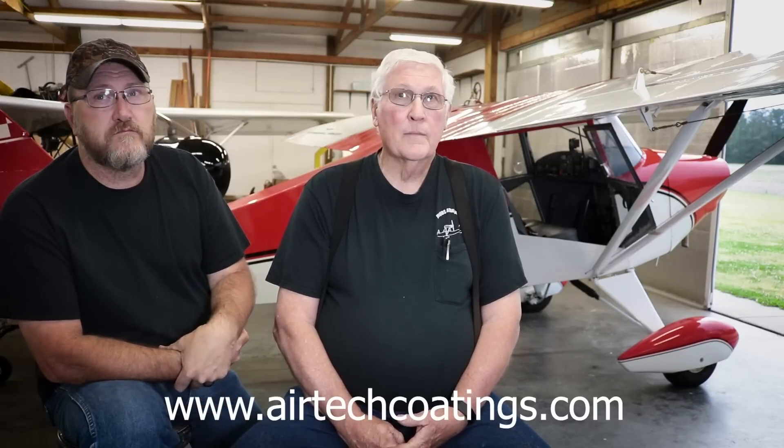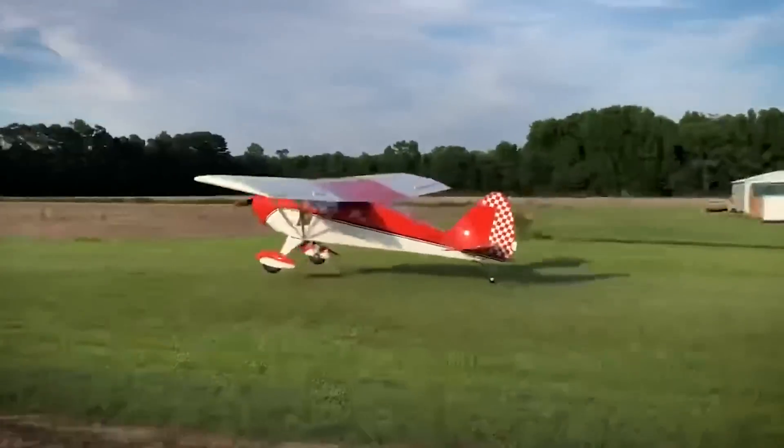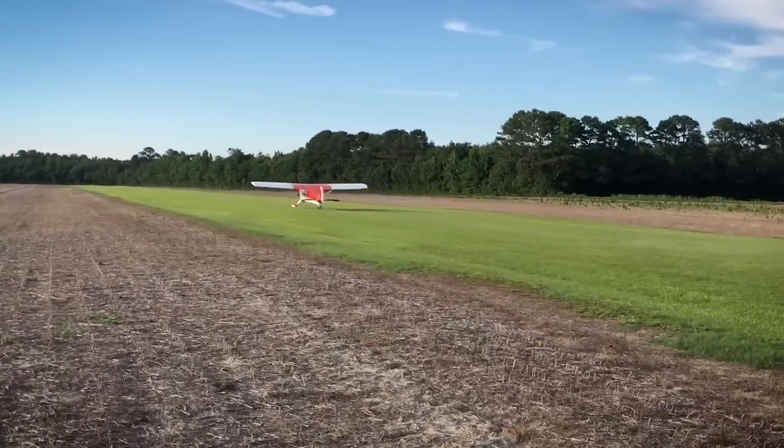Is the Wagabond pretty much built around the Continental O200 or just that horsepower rating? The Wagabond uses 65 to O200 on the classic. The Traveler uses 235 and on up. I think there's been some higher horsepower - there are some out there with an O320 on it, but that's a longer nose and heavier weight.